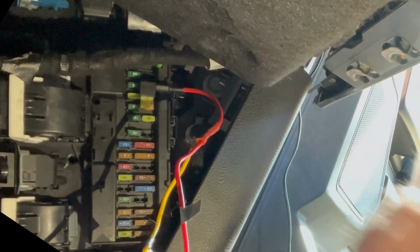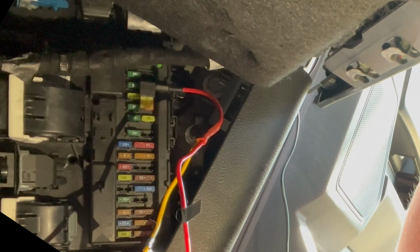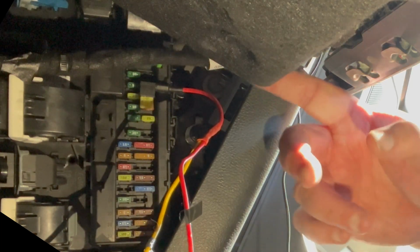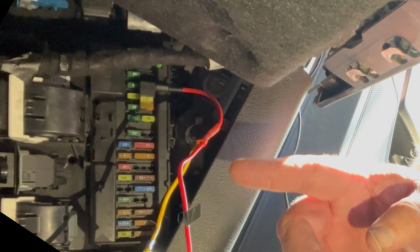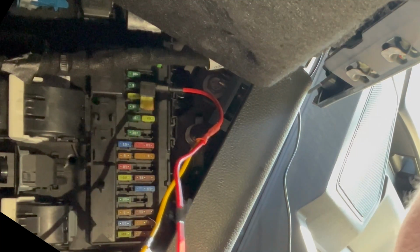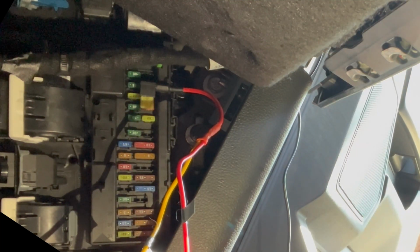And these are in. We got both of these wires actually hooked to one right now because I ran out of micro 2 fuse taps. But what we'll do in the future, because I just put it to the keyed on, which is that 10 amp up top, I'll put it to that keyed power. So when the truck starts, it'll go ahead and start up the camera. So that's what this one is up here. When I get another set of fuse taps in, I'll clip this one right here and I'll run that to one of these down here that's constant 12 volt power. That way when the car's shut off, it'll do the parking recording. But right now we kind of had to improvise, adapt, and overcome, and we'll continue running these wires.